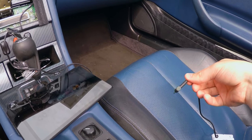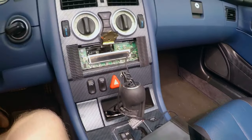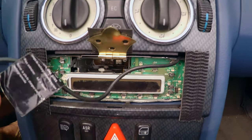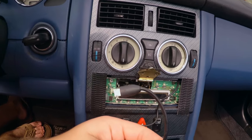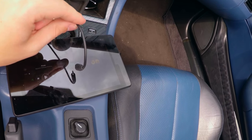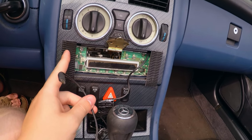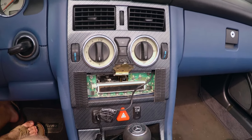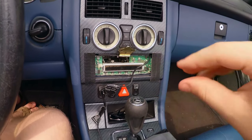Right now I have wired a wire from some old headphones in because the wire that came with the adapter is crap. This one just looks a little bit nicer — it's black, it's kind of thick, so it has a little bit of extra bulk to it. The other thing I have here is a cell phone charger. This is going to be responsible for keeping your tablet powered and charged. You want to wire it into constant 12-volt power behind your radio, which is pretty easy.